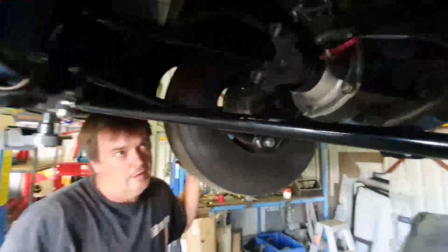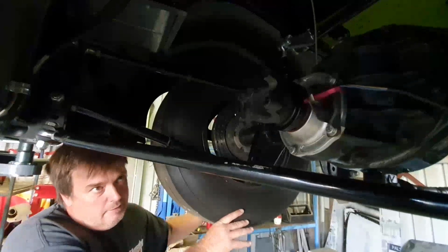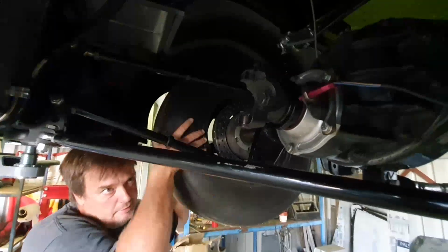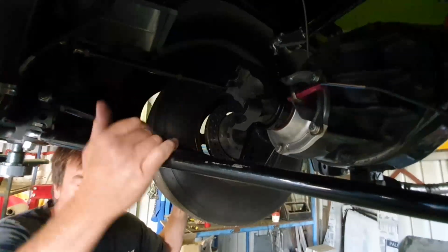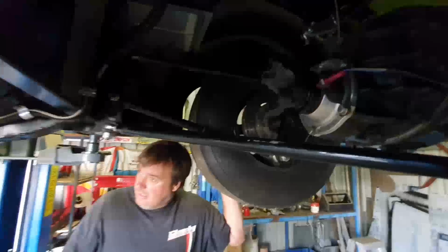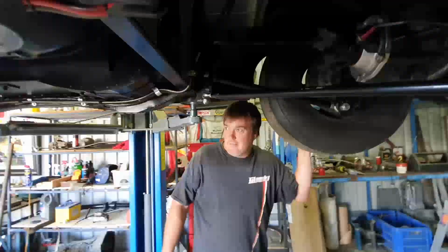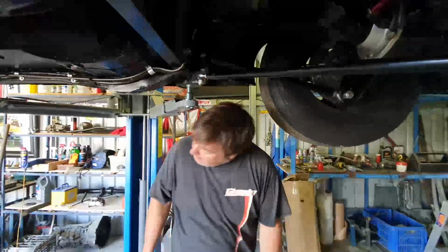triggering the race timer. So now, when the car gets to 5 kilometres an hour, the bump box will just, when you bump the car in, it only just shunts like that. So we got it set at 5 kilometres an hour. Then our timing curves will start. And that's what we found last meeting. The car took off real nice. So I think now we'll be able to chuck some power into it and get on with things, get after it a bit.